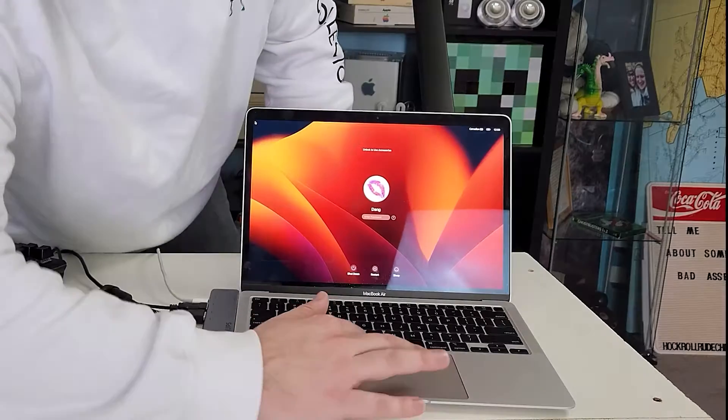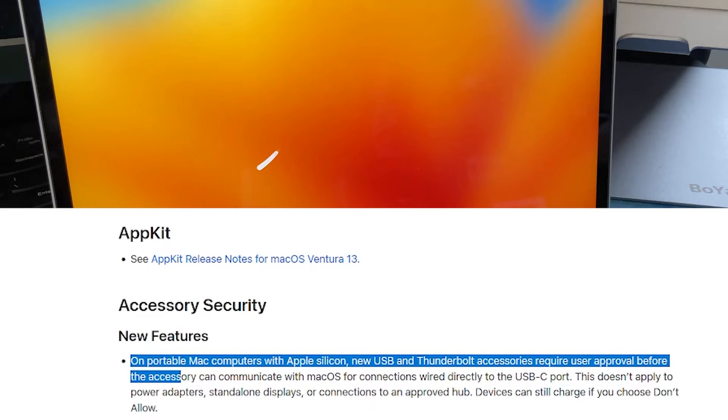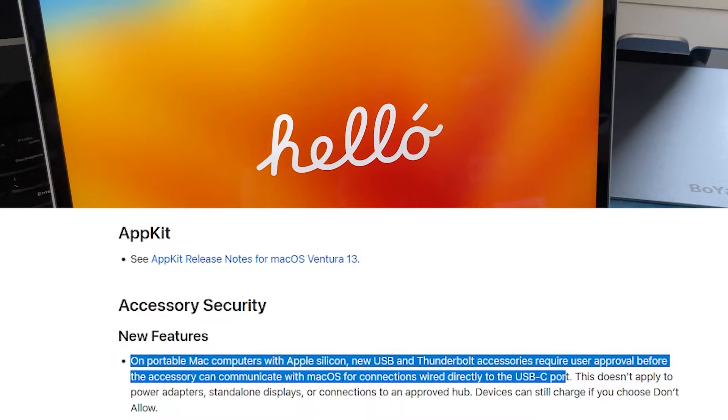How does that work? We knew that none of the keys were responsive — we had checked beforehand, and it wasn't just some of them broken by the coffee. The whole keyboard module was non-functional. As far as I've been told, coffee was spilled, killing the battery, trackpad, and keyboard. We ended up restoring it to the factory OS, which wouldn't have the USB lock in place. And the best part is, the USB locks don't occur in startup mode, so we were able to do everything we needed to. My only guess is that because it's a startup recovery mode, perhaps the three buttons complete a separate circuit on a different rail that isn't damaged by the liquid. It just seems really odd — but even if you are certain the keys don't work, try pressing the key combo for your device anyway.